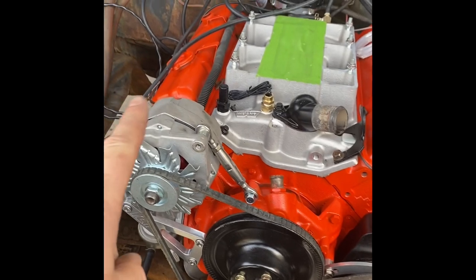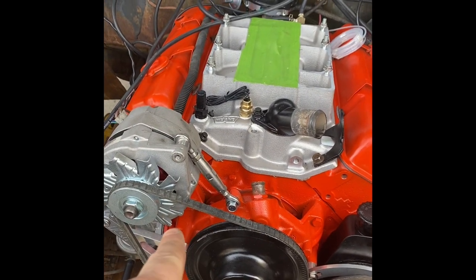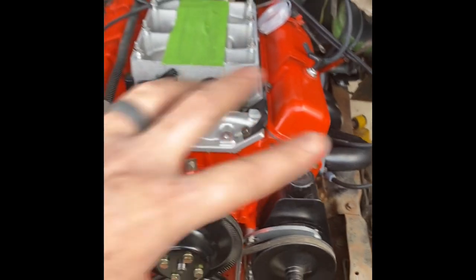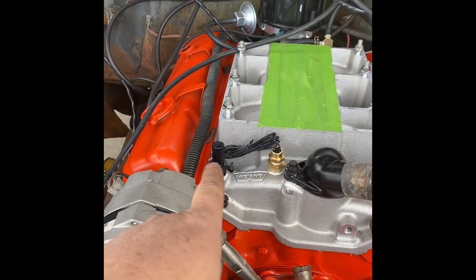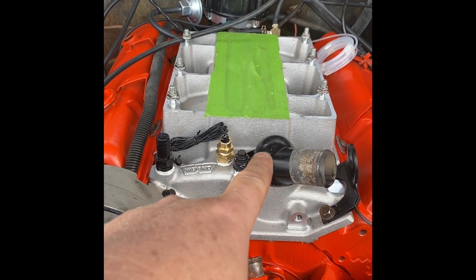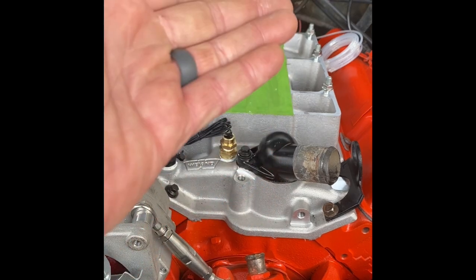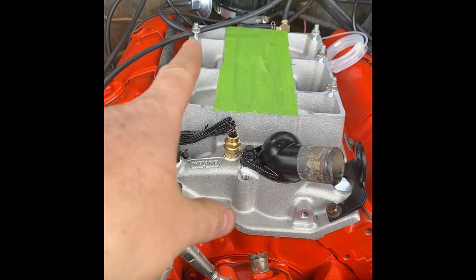Major project update. The engine's obviously in. Alternator, new reman. Factory power steering pump. I used the ICT billet accessory bracket kit — had to use a few 3/8 washers to get the spacing shimmed perfectly, but not a big deal. If you can rebuild a motor, you can align belts. Obviously the blower pulley, factory pulleys. That's a race car aluminum barb for the heater hose. That is the temperature sensor for the Mishimoto electric fans. Factory thermostat housing that I painted part of. One thing to note: you can't pull the thermostat housing off without taking the blower off. So there are some high dollar thermostat housings, but I'm just going to run this — if it's bad enough I can take the blower off, it's just six bolts.